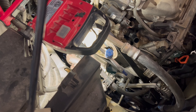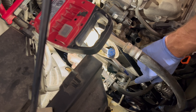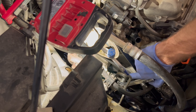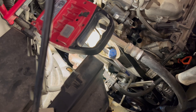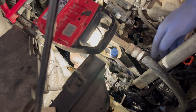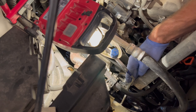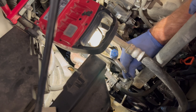Here's what I did — don't know if this is common procedure or just something I had to do, but I went ahead and put a 3/8 inch ratchet here. I've got a 14 millimeter short socket on there, and I took my little breaker bar extension here. Being careful because we've got one of the air conditioning lines right here, which is aluminum.